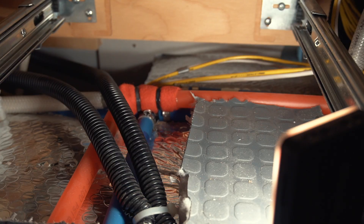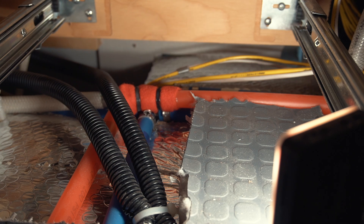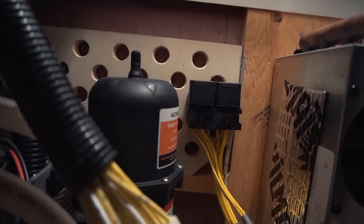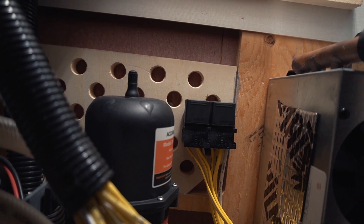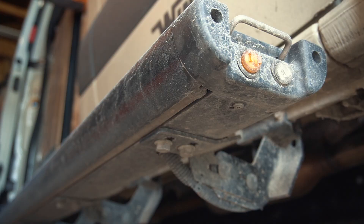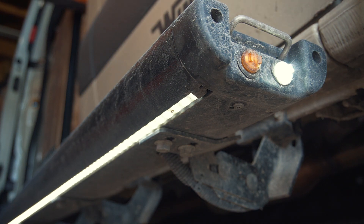While I was in here, I took care of a few other things. I wrapped some felt around the hot water pipe so the crimp rings of the cold water pipe no longer touch it. I also made a little bracket to better secure the cables up here, and I relocated two relays that were laying on the floor with all the other cables — I moved them up and attached them to the back wall. One of them is for the macerator, and the other is for the running board lights, connected to the PSM module so you're not driving away with those lights on.